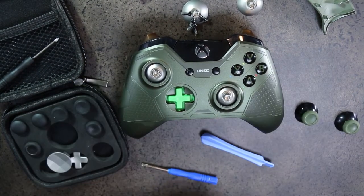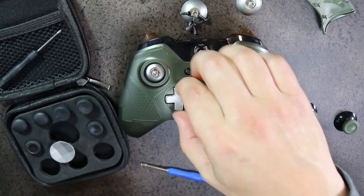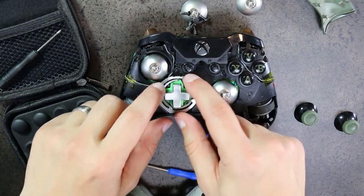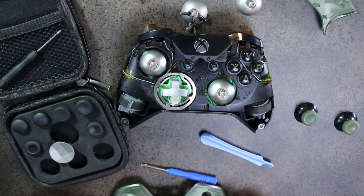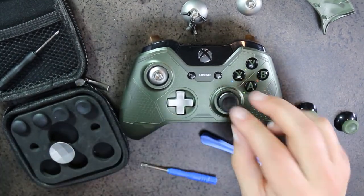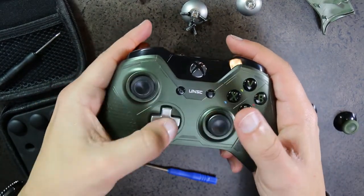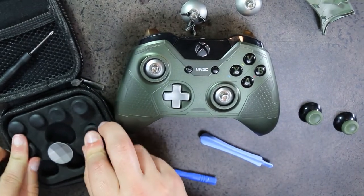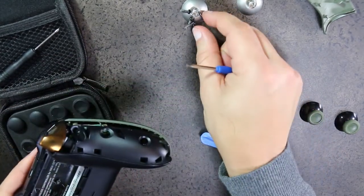Put the face plate back on. You can test the D-pad first to make sure it feels magnetic and tight. If it's not tight, push the metal teeth down so it holds the D-pad piece in. Once the face plate is on, put the joysticks on and test them out — move them around, make sure everything clicks and the D-pad feels good. If you feel good about everything, take the sticks off, flip it over, and start the screwing process. Fast forwarding through that.